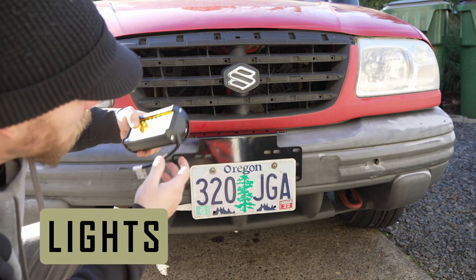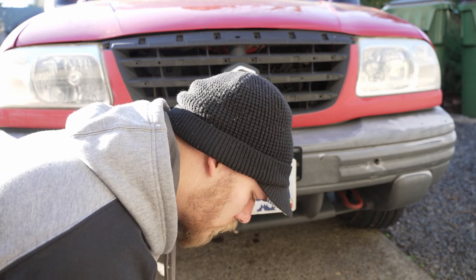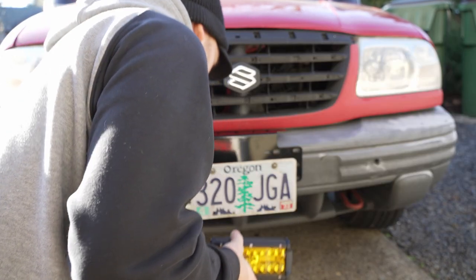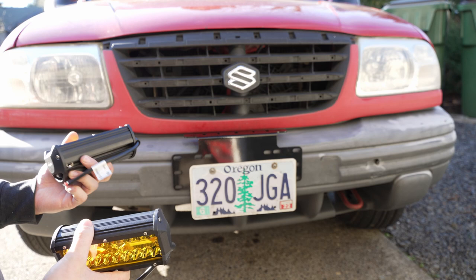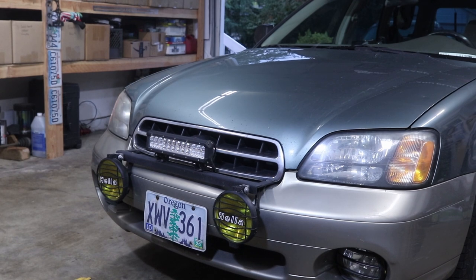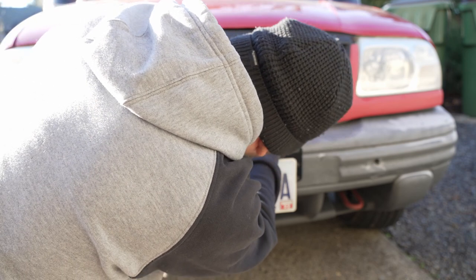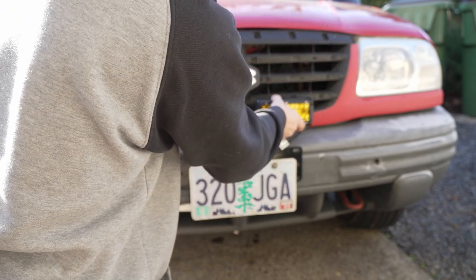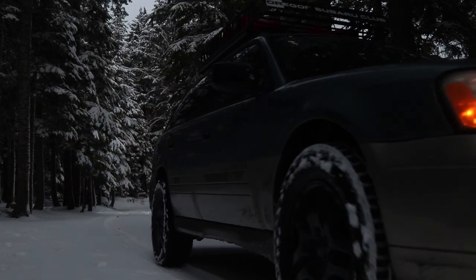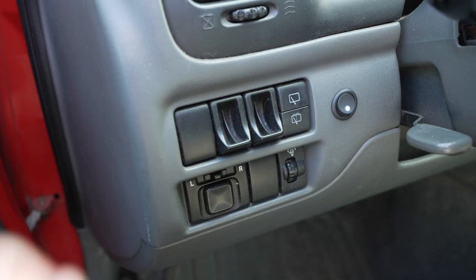You all probably know the saying — light bars before lockers. Well, we're soft roading here, so that's actually what I'm going to do. Not to mention, the price of a decent locker would cripple my $1,500 budget. So we're going for the Amazon special: a couple of 6.5-inch amber light bars from Nylite — about $30 of the budget. I chose amber because it really makes it easier to distinguish details on the road in fog and especially in snow, and my amber Hella 500s on my Subaru really boosted confidence in bad driving conditions.